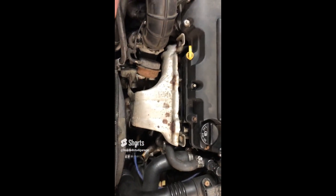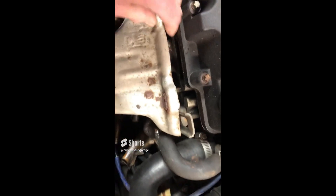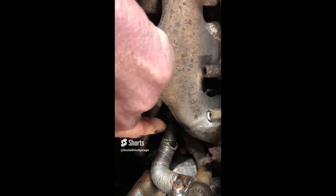Update on the Chevy Cruze: the coolant leak — we got a new tank in there and fixed the other holes, but it was still going down a little bit. I did some investigation, removed the hardware for the heat shield, and I can see right here on this rubber hose — the coolant hose to the turbo is leaking.